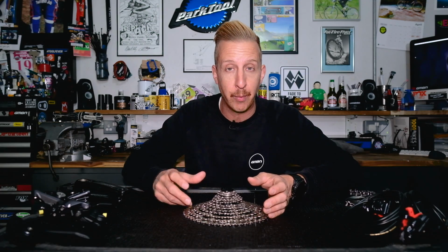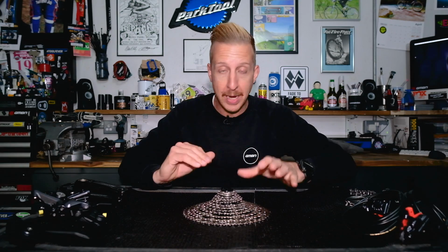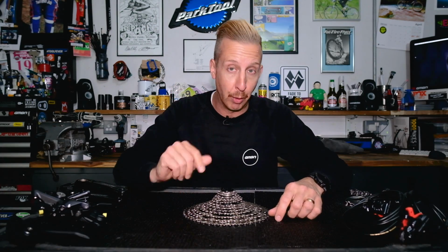Now, bearing in mind that you're doing this with your chain under tension basically the whole time. When you're shifting back down again or shifting into a smaller sprocket size or a higher gear, your derailleur is not under tension in the same way, you're releasing tension. So the downshift has never been quite as good as an upshift. But this is where Hyperglide Plus comes in, because it's actually got the same ramps in a different direction, designed to pull the chain back down the sprockets again. Now that is incredible. It shifts exactly the same up or down, under load or not. Amazing shifting quality, the same as you expect on SLX, XT and XTR, and you're now getting this at the Deore level. That is bonkers.